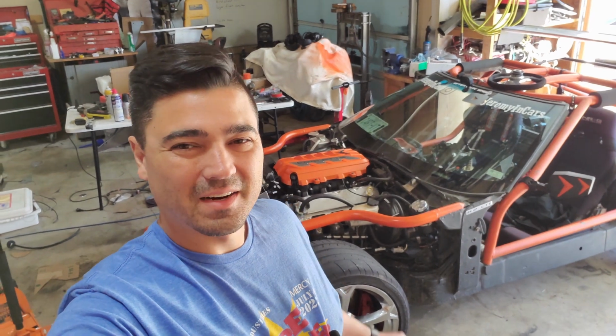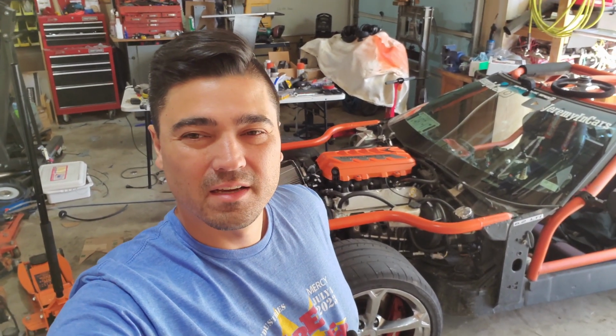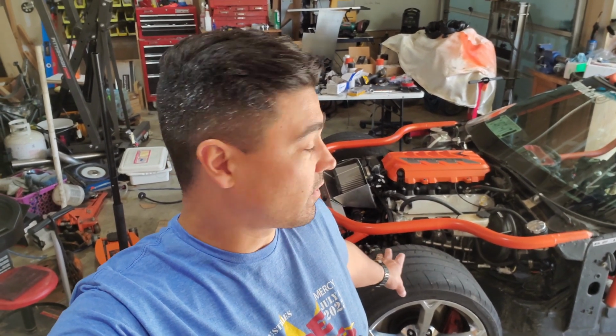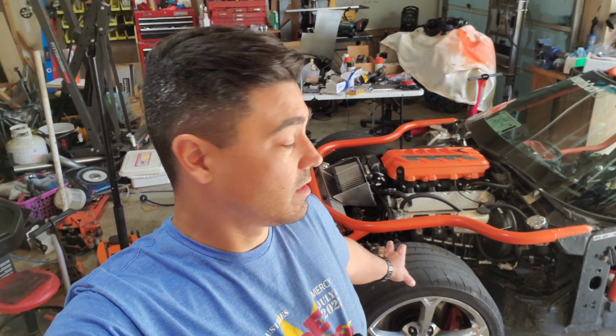All right, all packed up and ready to head to the racetrack. Figured I'd take a minute here and just cover what has changed since our last HPD. So first is a bigger brake kit up front and moved from the Carbotech XP8 to the XP10 pads up front. So I'm hoping braking is a lot better. It was a little weak at the last event.